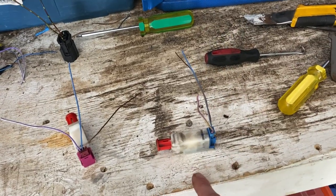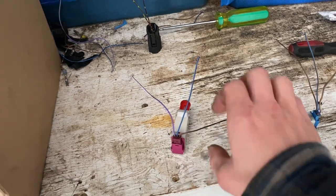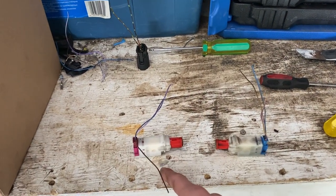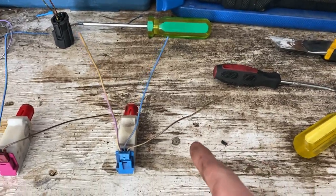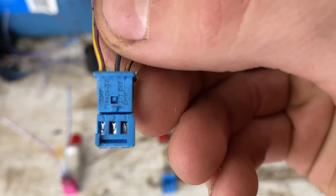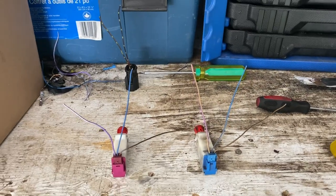This switch is going to be sitting at the front of your pedal when you're looking at your pedal assembly from inside the car. Your clutch is always going to be sitting on this blue switch, and when you push it down it makes contact with this one. You should have a purple and white wire or a purple and yellow wire, and you should also have a brown and black wire on both ends — those are both pin number one. If you lift up your little connector, there's pin one, two, and three, so they'll always be numbered like that.